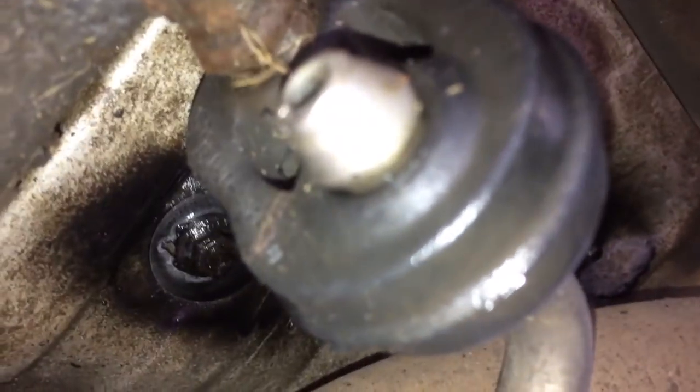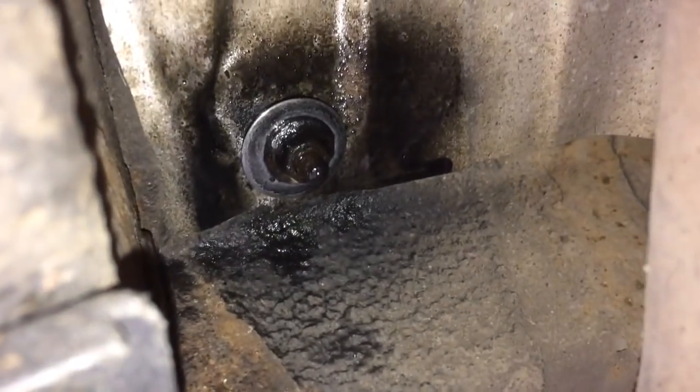That exhaust mount is fine, that's perfect. Moving down the back of the car there's another little one here which is corroded, so I'm going to have to put a washer on that. I use a 10mm socket on a quarter inch drive ratchet to remove these fixings. I'm going to put a really big washer on there because where it's corroded it will just hold and clamp that back in place rather than rip it out — it's nice to have a heat shield because it does do something. The bigger washers are on now, I've given them a little spray with some black paint just for protection. This fixing here was loose so I've redone that, which stopped that rattle.